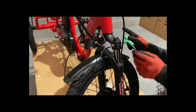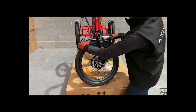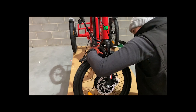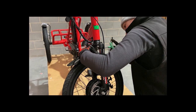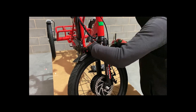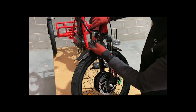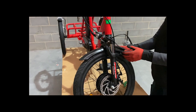Start twisting to the right. Don't worry about the light being a bit wonky at the moment. You also want to make sure you push the fender up when you put it in, because otherwise it's going to get caught on the wheel. So you see how it's quite low — just lift it up, and what that'll do is give you some clearance on the wheel. Tighten it with the number five — you want to tighten this to hand tight. The advantage with the front light is it does pivot here, so you can always lift that up wherever you'd like it, whether you want it pointing to the ground or where you're heading. We'll cable tie this a little bit later, and that is your front fender on.